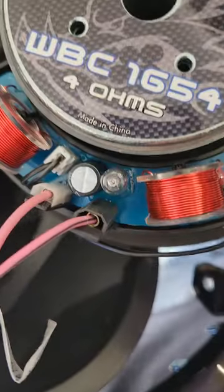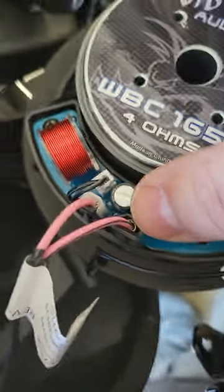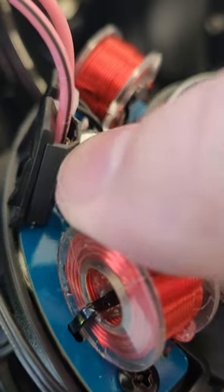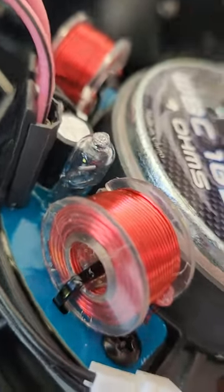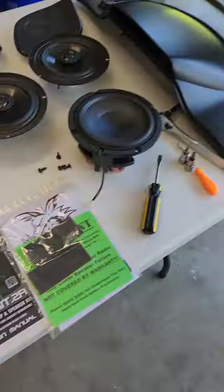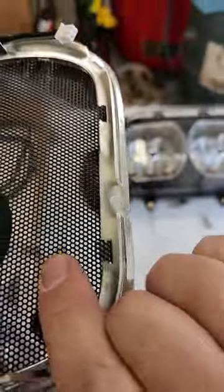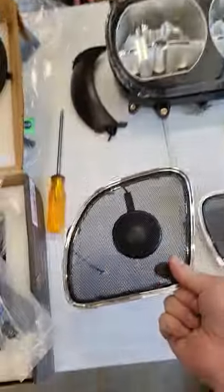Putting these speakers together, when you get down to plugging them in you'll see that one is a little bit smaller than the other so you can't really screw these up. The pink one with the white one goes here on the left, the black one goes on the right. When you put these all the way down they'll actually snap in and the little clip will hold them in place. Put them straight in there, then tip the speaker into position — you're going to have to wheedle it around a little bit. Get the side started. Once you've got them all settled down, go back for your grills. When pushing those little tabs over on the back to tighten those up, don't crank them all the way down — you don't want to snap the plastic. Six of those all around there snapped into place and you're good to go.